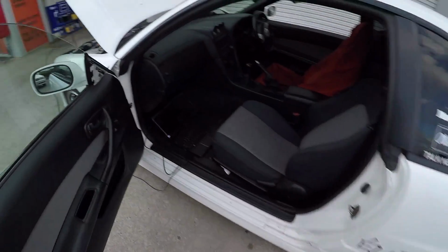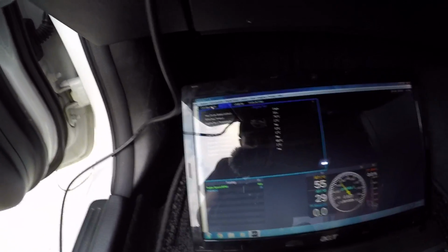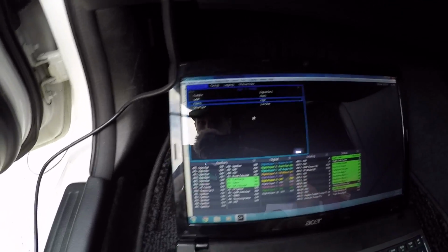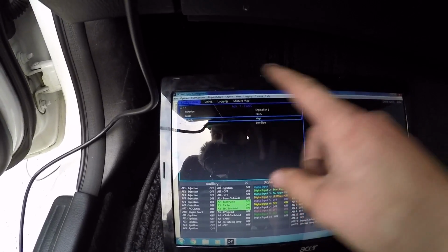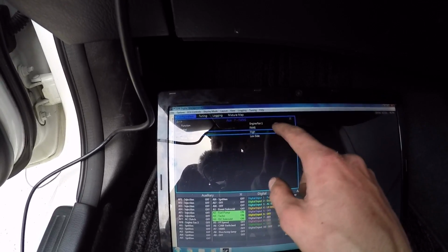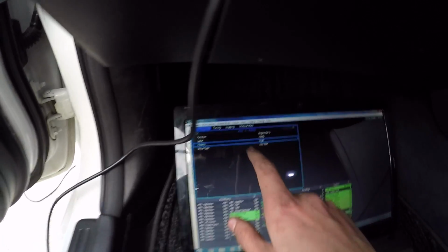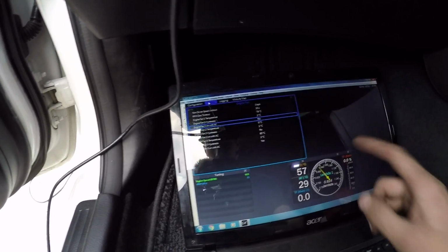And how I have it set in the Link ECU is, I'll show you first. Here I've got this particular auxiliary, which is auxiliary 7, that comes out on the O2 sensor trigger wire. And what I've done is I've told it it's for an engine fan 1, I've made the polarity high and the driver type low, which is what sends it 12 volts to trigger it essentially.